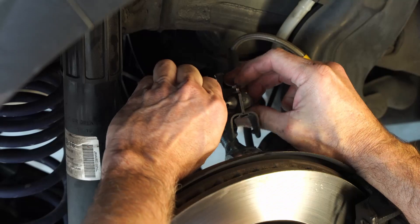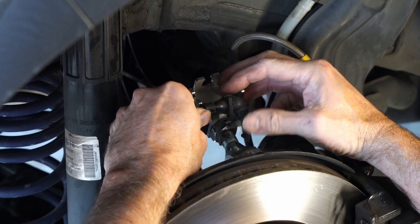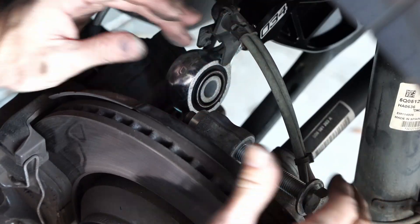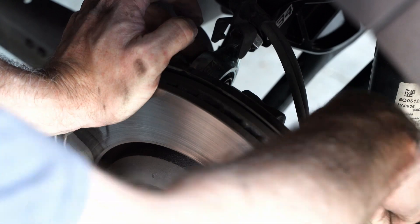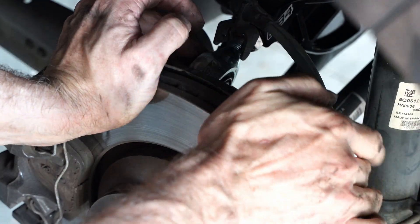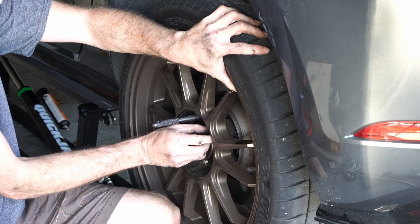You can see here my brake cables the way they are run in the car did not really play nice with the brake cable brackets that came with the kit. So I ended up just ditching them and zip-tied the brake cable right to the bushing rod. I removed both brake cable brackets and you won't see those moving forward, but they may work fine for your vehicle — they just didn't work for mine.